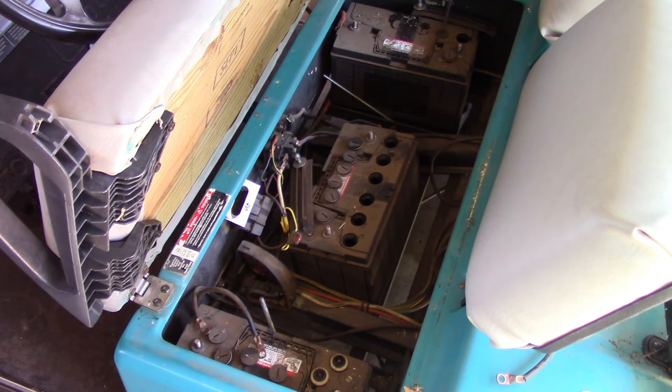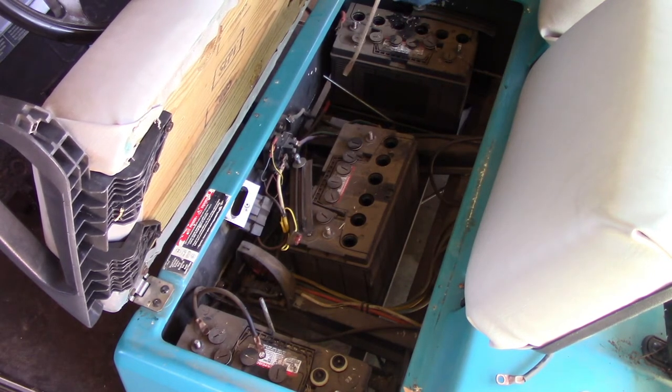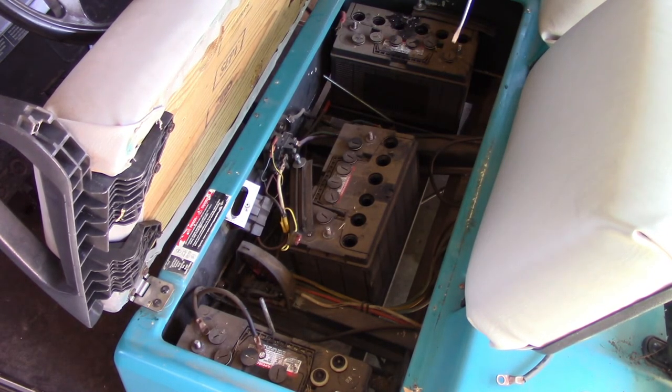You're not running the risk of damaging your electric components that might get shorted by the current being quickly introduced in the wrong direction. Most cars do not have a protective circuit or a diode because of the way that their ECUs are on the backside of a relay that provides them with power. Now, if you're providing power, you're backfeeding on the other side of the relay, it just bypasses all the filtration that could be happening there. And there are other reasons. Again, I'm not going to go into it, but I've had it explained to me by my electrical engineer friends, and I trust them.